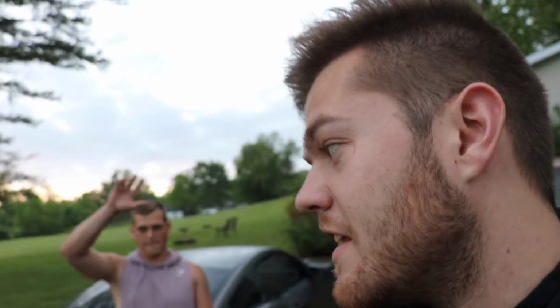Guys, I'm here with my buddy Austin and his 2014 car that you all have seen on the channel, but it's a little bit different. We've teased it a little bit now, but in short, the car went from a Paxton 2200 SL, correct? Correct. To now an On3 single turbo kit, 76 millimeter. So it's the On3 single kit, and it's on the base tune right now.